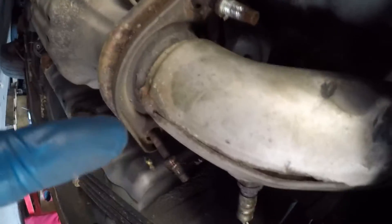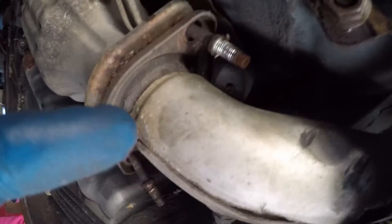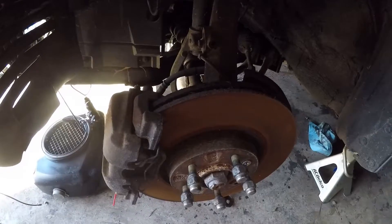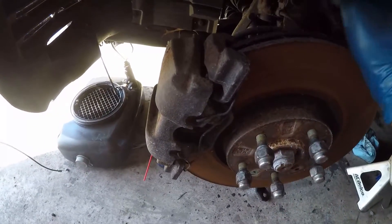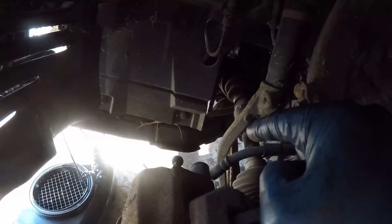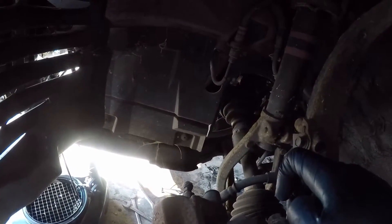I've got the exhaust disconnected right here. This one actually bent over to the side — I thought it was going to snap off but it didn't. They're both 14 millimeters. I also have the drive shaft disconnected. So my next big task is going to be getting the axles out. These will be the easy part — they're 36 millimeters — but the hard part is going to be figuring out how to pop the drive shaft out of the transmission. On both sides I think they're both clipped, whereas on the Speed 3 one side just slips in because the intermediate shaft holds it in place. But on the six, I'm pretty sure they're both clipped in on the inside of the trans, so you have to pop them out.